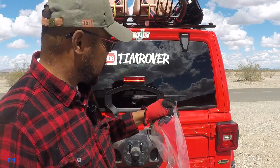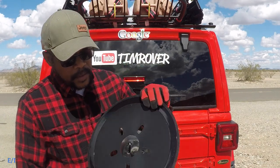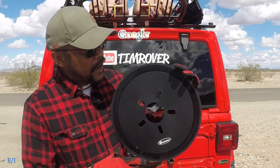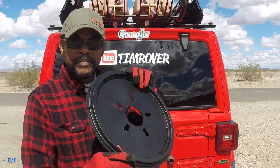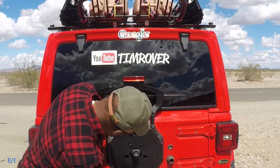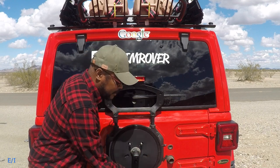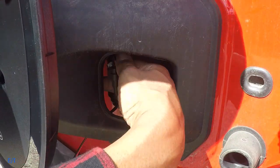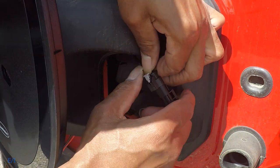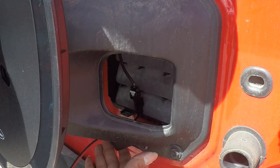Now we have this connector here, and this is the ring. I'll remove the plastic and set it aside. Around this ring you have a series of LEDs, and when you step on your brake these LEDs illuminate. You take this little plastic panel and put it on here just like so, and the tire is going to go over this. This connector is going to go on the connector I showed you earlier. I took the wires around the inside of the housing for the tire and connected them onto this connector — press down, make sure it's connected, and leave it inside the housing so it doesn't get frayed from the tire.